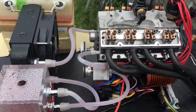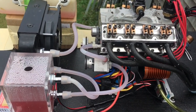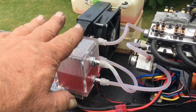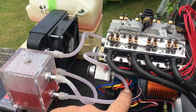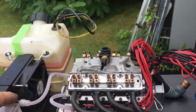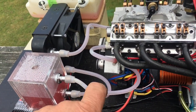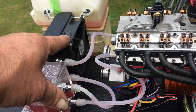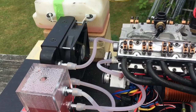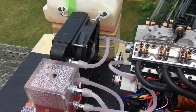This engine has just first started, so there's a ton of friction going on and it gets hot. I've got my overflow jug with coolant coming from the bottom into the pump, out of the pump into the block, out of the block into the top of the radiator to cool it down, then back into the overflow. I've got a fan on here from Engine DIY — it's for the 36cc engine they advertise.